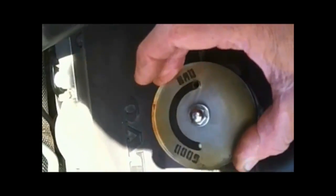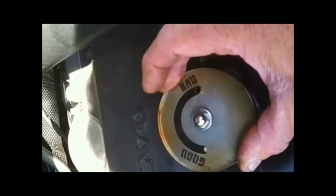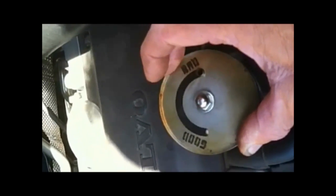Okay, you see the ball went to the left. Now I'm going to do a power boost — go ahead and give it a boost. You notice the ball stayed on the left side with vacuum. So even under boost, the engine is supposed to hold the vacuum. This is a low-mileage engine, so it's not very worn out yet and it's still not having a problem with this breather system. That's what you're looking for.